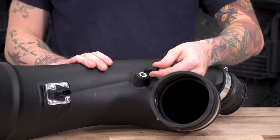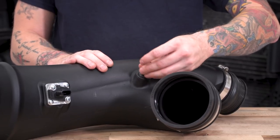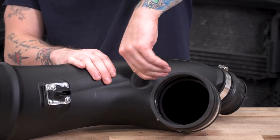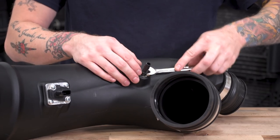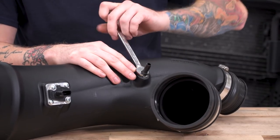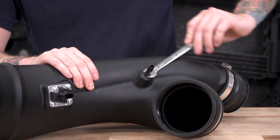Now install the little barb fitting in the hole on the intake tube for the crankcase breather hose that was removed earlier. If your truck does not have a hole in the intake tube for a breather hose, there is an Allen head bolt you can throw in — use an Allen head key to secure it and close that hole up. That way you're not getting any extra unmetered air into the manifold. These are plastic threads so hand tighten first, then give it a couple of turns with an 11-millimeter wrench. Make sure it's nice and tight but don't strip it out or cause any leaks.